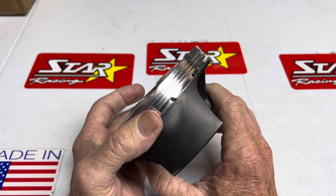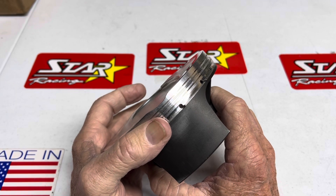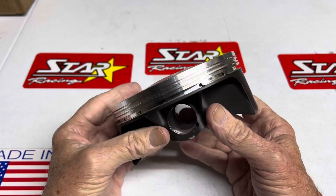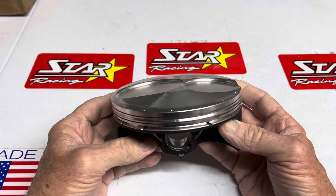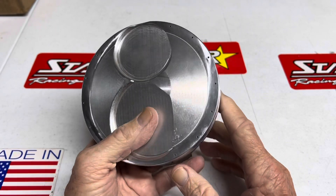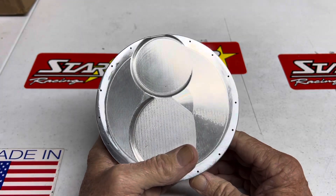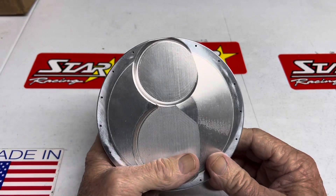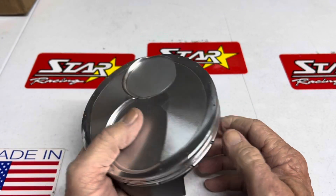I know it's hard to back-to-back that, but there is no measurable back-to-back difference between a 13-pound oil ring and an 8-pound oil ring. And if you have really weak oil rings, you have greater potential to put oil in the chamber and detonate. We want all the octane we can get out of 93-octane street gas, and if you let a little oil in there, it'll drop into the 80s right away. So the gain on the oil ring is just not worth it.